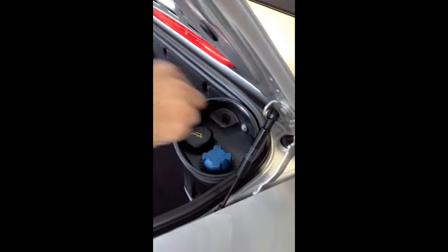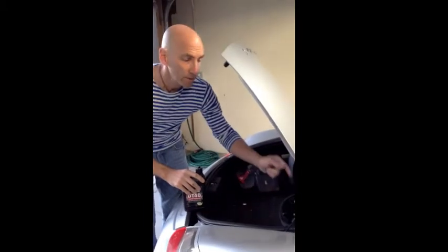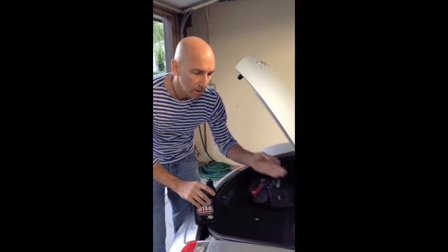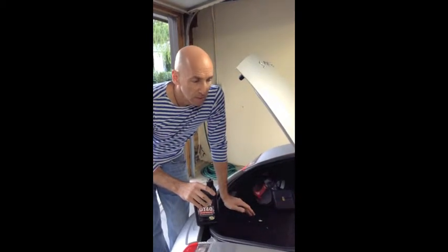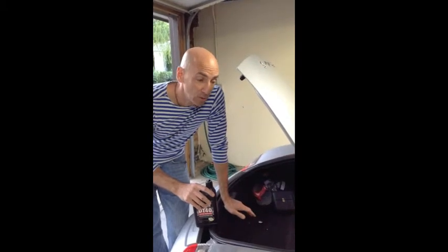So we've put in 5 quarts — just checking. I checked underneath the car, no leaks. We put up to 6½ quarts in, checking the dipstick and also the key gauge. I would put it in half-quart increments: 6½ to 7, 7 to 7½, always checking. We got it up to 8 quarts and it was just registering about midway on the dipstick.